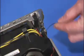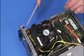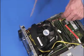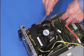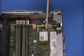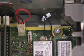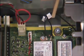Replace the rear antenna into the cable guide on the rear inside wall of the PC. Replace the rear antenna cable into the small cable tunnel next to the motherboard. Replace the antennas to the wireless LAN board. The antenna connectors are labeled 1 and 2 and should be connected to the corresponding 1 and 2 labeled ports on the wireless LAN board.